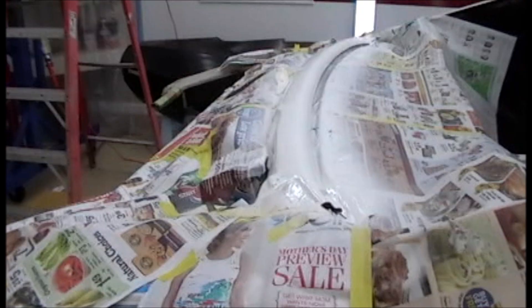Late tomorrow evening I'll block it out with 180 and then I should be ready to sand that whole panel. I've got to get in the gutter area with 80 grit, and once I do all that I'll be able to sand it down, then put two more coats of white epoxy over it and call it good and move on to the next part of the project.